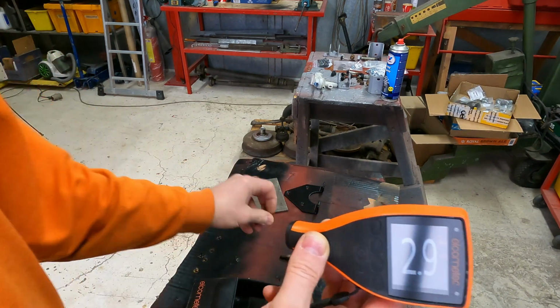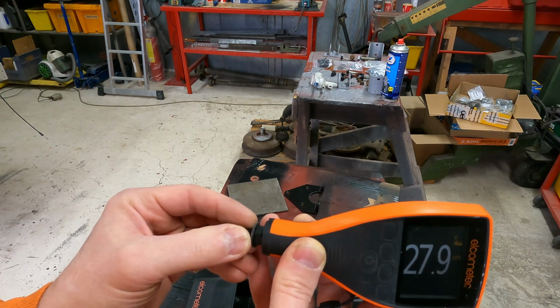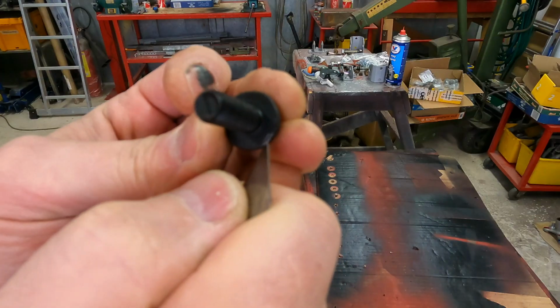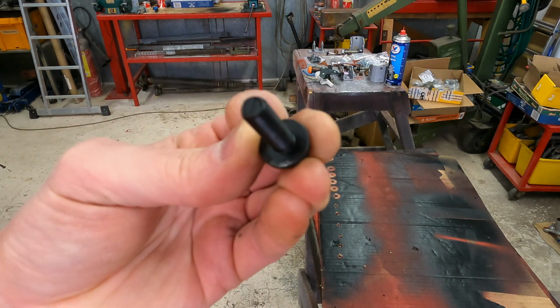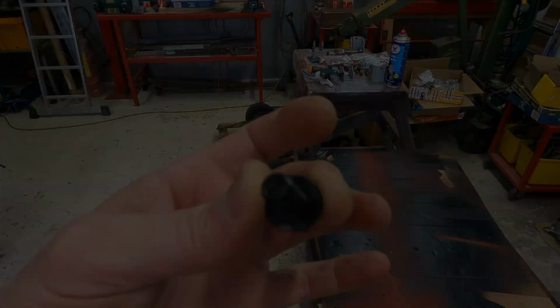If I show you bare sheet metal with dirt on the surface, you can't get zero, but it goes near zero. And if I measure this bolt, I get bigger readings anyway. So there should be some kind of coating. If I scratch here, I can see the bare metal appear. So there is coating. The bolt store didn't know that.